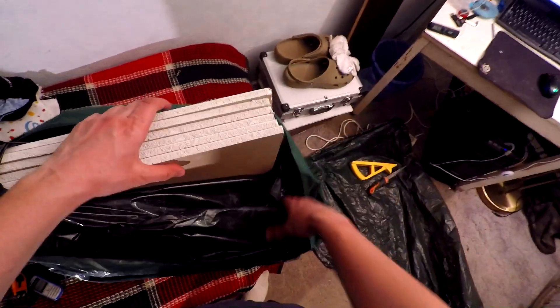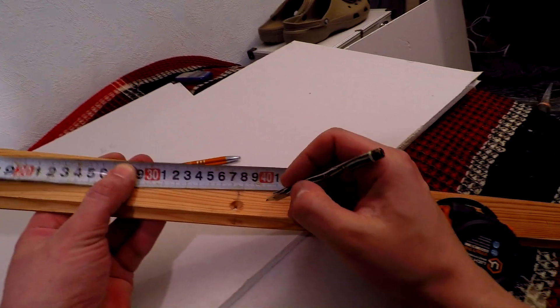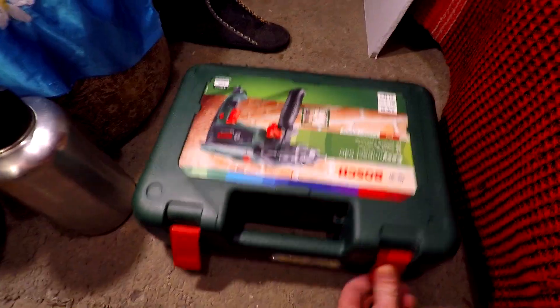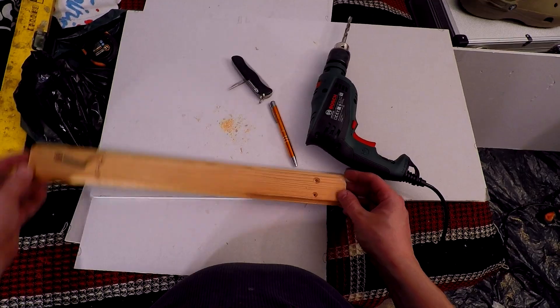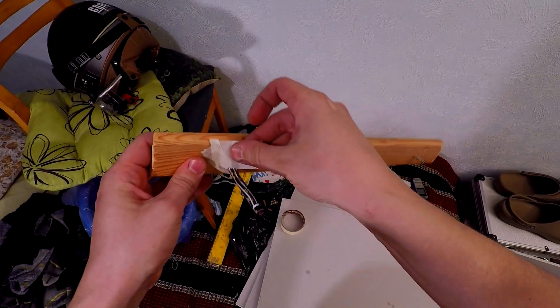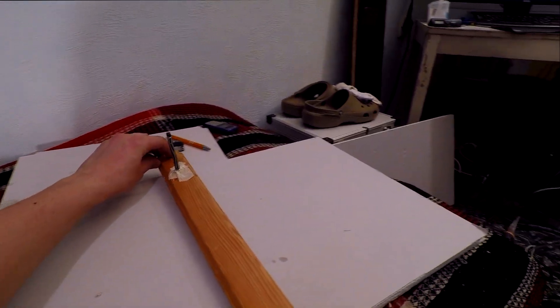For the mold, I use gypsum boards obtained completely free of charge — surplus from construction works. The first thing I measure is how wide and long the arch would be. I will definitely put a hard margin of a few centimeters for safety reasons. I don't want a situation where the arch could bump against the wheel while driving. I use a wooden board to draw the diameter with a screw attached at one end and a pencil at the other end, giving a total radius of 34 centimeters and a total arch length of 68 centimeters.